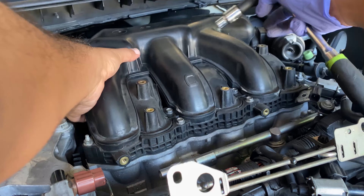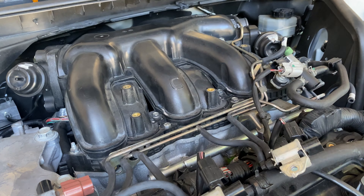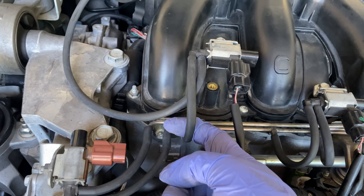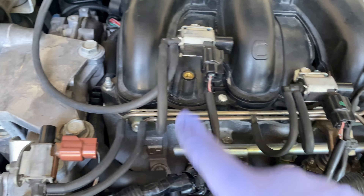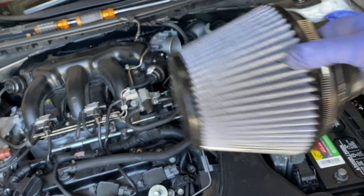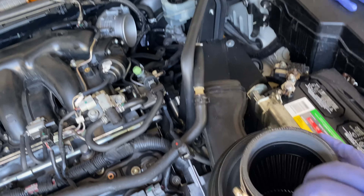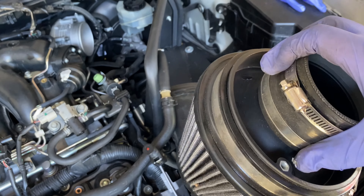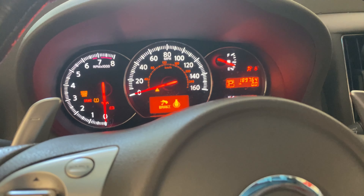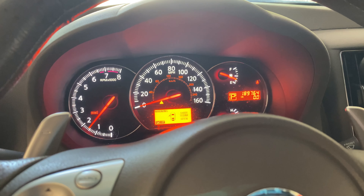We're going to put these plugs in right now and hopefully get this finished in about an hour. One, two, three — and this one doesn't seem to have oil on either the coil or the spark plug, which is good. So these are the Hitachi coil packs — these are the OEM original brand for this car. You can also get Denso, both are made in Japan. Honestly, if you don't want problems, just go with OEM. If it's too expensive, find a quality alternative — just don't go with a cheap off-brand. Denso is a solid Japan-made alternative; Hitachi is just what Nissan uses on a lot of their products.